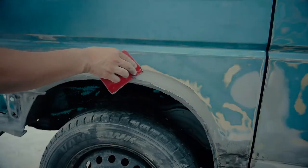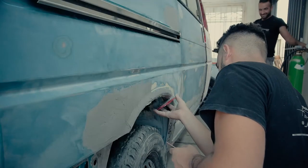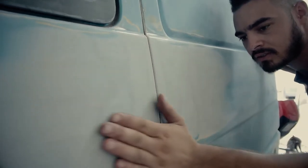They also create an ideal surface for the color coat paint. I suggest always choosing a high-quality automotive primer developed for use on metal surfaces, and make sure the area you're covering is really clean. Normally, you should apply two or more coats of primer to ensure the bare metal is completely covered. Then stop and inspect the area — you can see all the small details and imperfections and fix them. You can remove any bumps by re-sanding the area. It's absolutely normal to repeat this process more than a couple of times to get it right. This is the best tip for a flawless, professional finish.